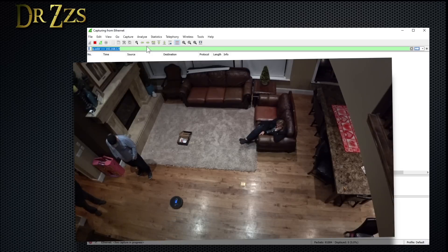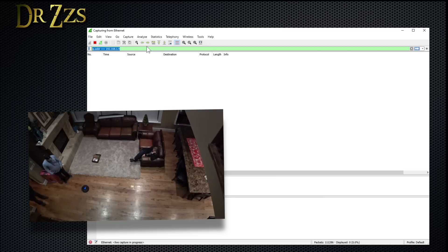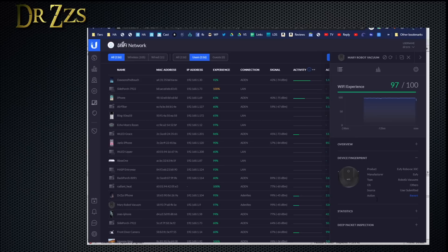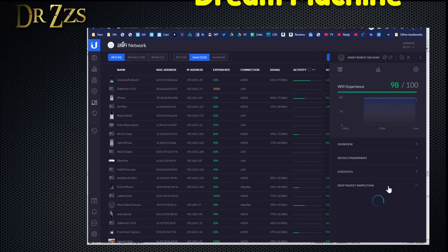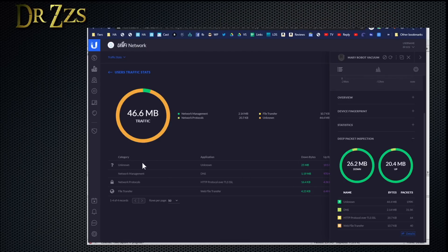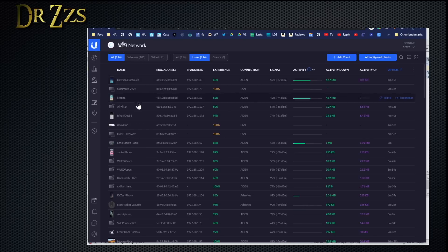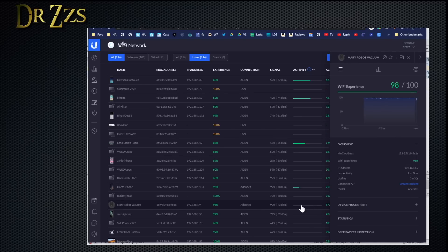Yep, there she goes. She's cleaning, so we're going to watch this and see if she does anything. It does not look like she's doing anything. The other thing we can do is look at the router and check out deep packet inspection. It looks like she downloaded a little bit of stuff and uploaded a little bit — most of it is unknown traffic to some unknown place. That must have happened right at the beginning; that might be a firmware update. Only a few kilobytes of web file transfer, so that certainly is not going to be pictures. Same here — HTTP, but that's not going to be pictures either. If we look at what she is currently doing on the router, there is no activity at all.